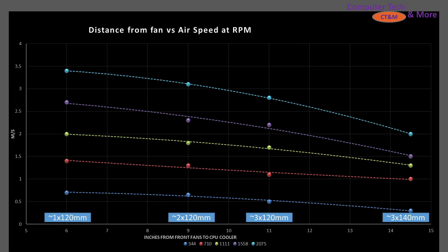This is going to be looking at a couple of different ways — how good is this fan at focusing its airflow, and for you the viewer, how good is this fan in different types of computer cases. The first is the 6-inch mark, which would be like an ITX case — a front-to-back airflow into an air cooler. All of this testing assumes that you have an air cooler. The 6-inch mark is also representative of a short throw distance, like having a fan in the bottom of your case blowing air up into your GPU, or an inverted case blowing down into your GPU.